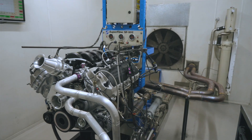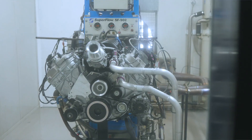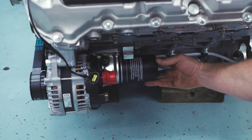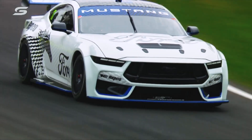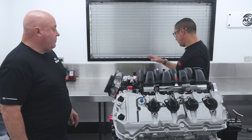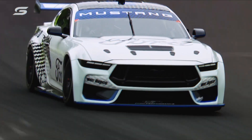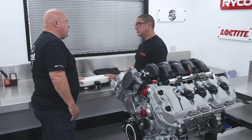As far as life expectancy and mileage out of these engines — Ryco are our filtration partners and they've been a great help, working hand in hand with everything we've done with these filters. We believe these engines will see around 10,000 kilometres total life, with a mid-service at about 5,000 kilometres. We like to see the oil and filter changed at each round. So far the engines have been very reliable — we've had engines on an AVL dyno at Ford in the US doing durability testing and we've done over 5,000 kilometres non-stop without any issues whatsoever.